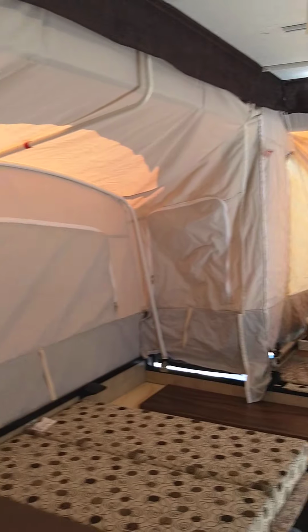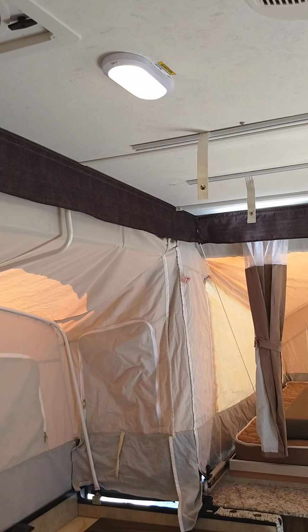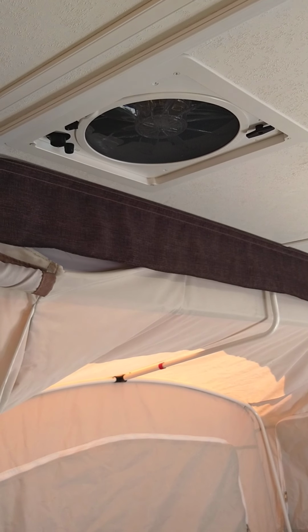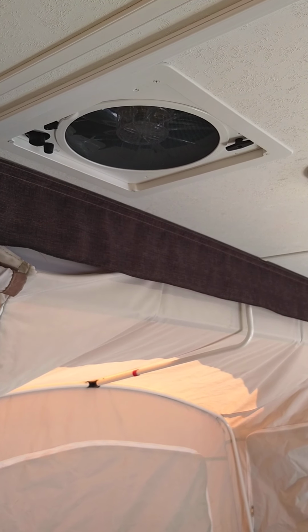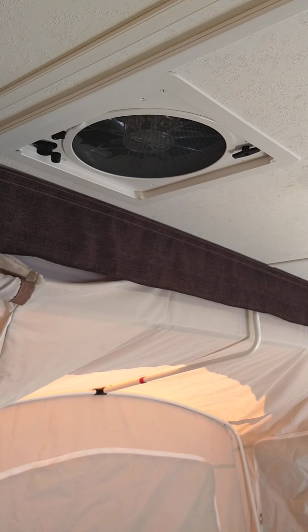So you're going to inspect the outside of the trailer. You'll inspect the corner caps and where the vent is. Make sure the seal is always really good there. Some year, somewhere down the road, it may separate because these things do flex down the road. So you can re-caulk it. Just make sure you don't use caulk from a hardware store. You want to go to an RV place and get something called ProFlex, and that's what you use on it. Never use silicone from a hardware store.